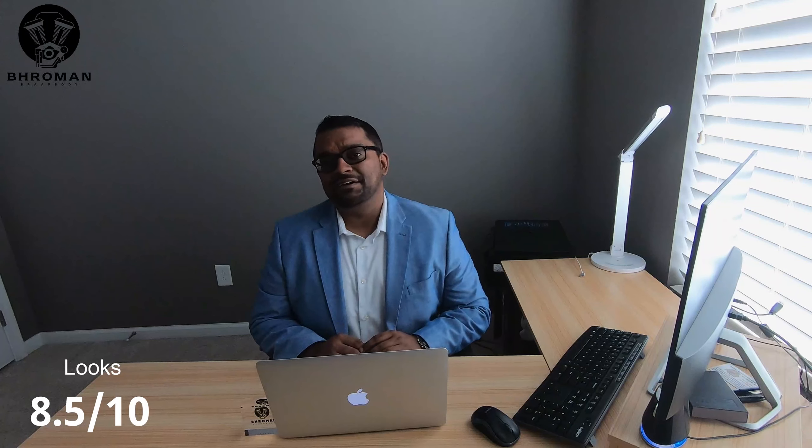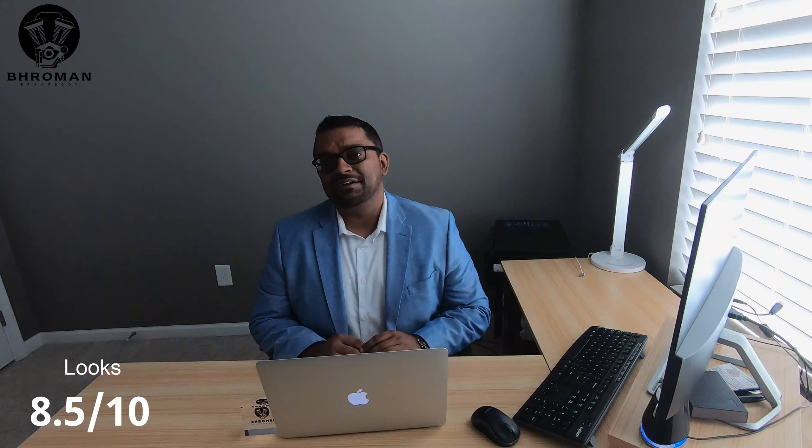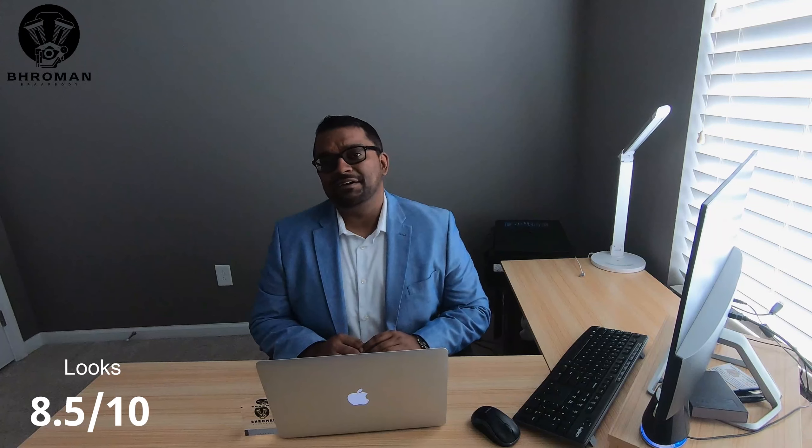Let's talk about the cost of ownership. If you like what we do here at Broman, please give us a like, subscribe, and click that bell icon. The average rider in the US does about 5,000 miles a year. You would need an oil change at every 5,000 miles, new tires at every 10,000 miles, and since it's a shaft drive, you need to change the shaft oil or differential oil at every 8,000 miles. Over a 2-year period, that's 2 oil changes at about $120 each, a set of new tires at about $350, and shaft oil at about $20. So yearly cost is about $305 divided by days — only about 84 cents a day.